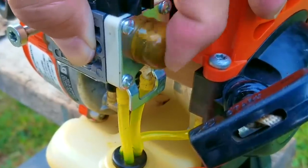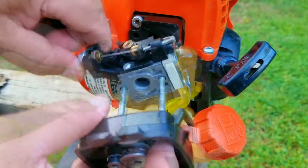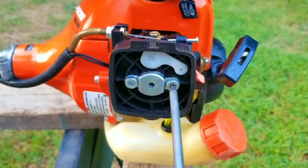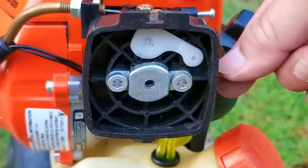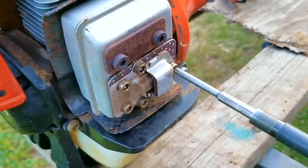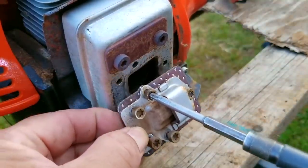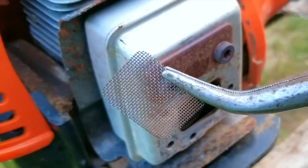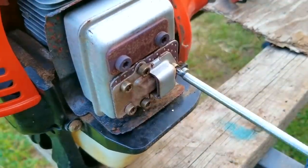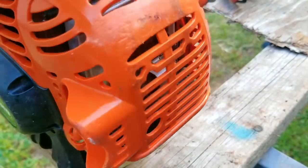The fuel is flowing through the lines like it's supposed to. If the fuel comes up the return line first instead of the filter line, you have the lines reversed. If you don't see any fuel coming up from the tank, you either have a carb issue or your fuel filter is clogged. Since ours is doing what it's supposed to, we'll finish installing the carb and check to make sure the choke is working like it should. The hammer method seems to have worked. Before trying to start it, I want to check the spark arrestor screen in the muffler's outlet to make sure it's not clogged with carbon — a clogged screen means the engine will have a difficult time breathing, especially at full speed. We can see right through it without any issues, so there's nothing wrong with it. After getting the air filter back into place, I think it's finally time we try and start it.